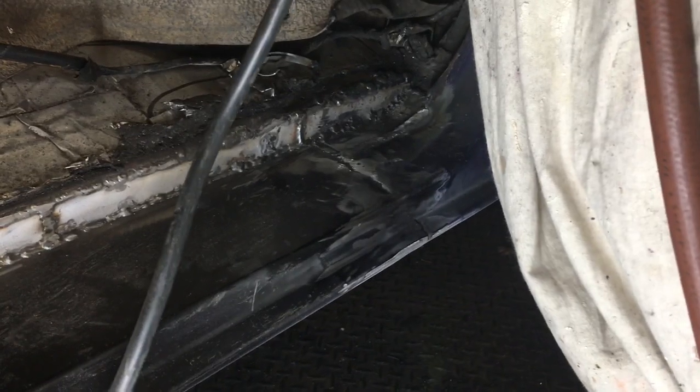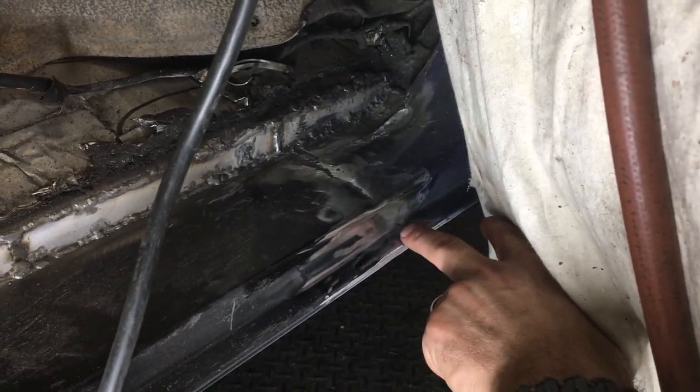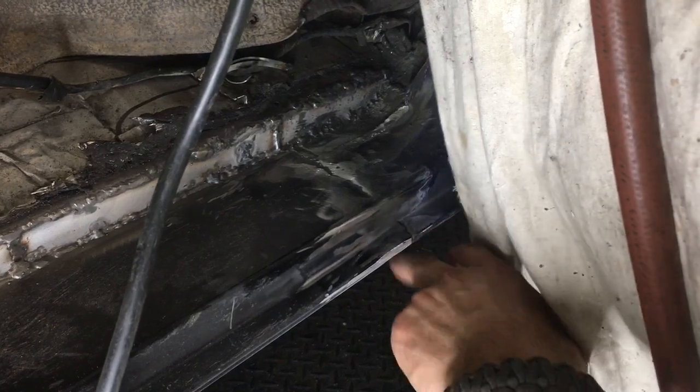Don't mind my hideous welds — I hate them just as much as you guys. They could have been better, much better. That's the trouble with trying to weld metal that's partially rusted — it just doesn't work out really well. If you guys are doing this and have a little extra time, just cut back to here and replace it with new metal, because trying to weld over rusted metal is nearly impossible. I ended up just taking plates and welding it in front of it. Thank God seam sealer exists because we're going to seam seal the hell out of this including the underside. It's also going to get undercoated and painted — there are no holes in it.